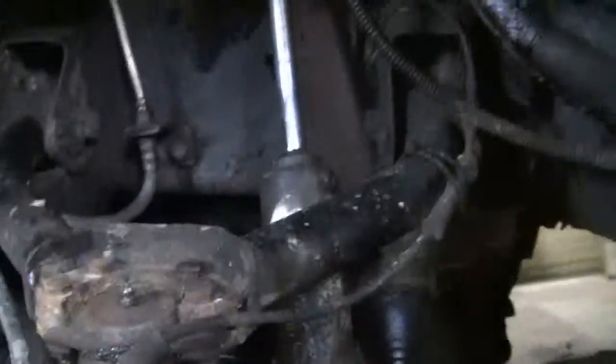Okay, what you're going to need is a breaker bar and two 20mm sockets. It's worth mentioning that my shocks are aftermarket ones. They're Pro Comps. So if you're doing this off a stock '99 Silverado, I would say your bolts are going to be different. And follow me.